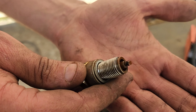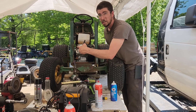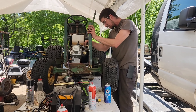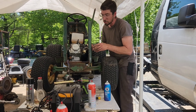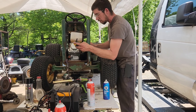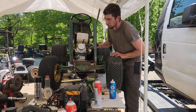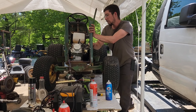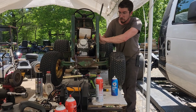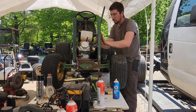That's covered in something that looks the consistency of mud water. We've literally had rust coming out the more we oil down through the spark plug cylinder. I think we got the valves to reseat, which is what I think was our previous issue. Let's leave it unchoked and crank the idle way high — we know we're in neutral right now on the machine, so I'm not worried if the engine flares up. Okay, give it some throttle, try it again — choke, throttle.